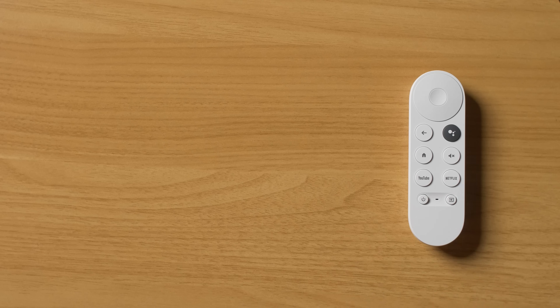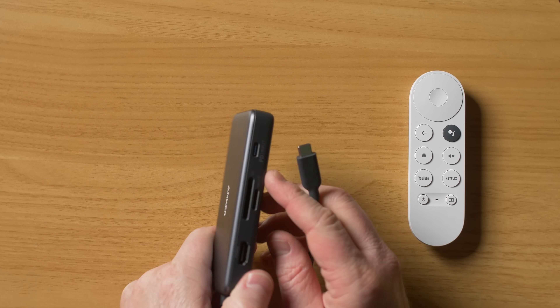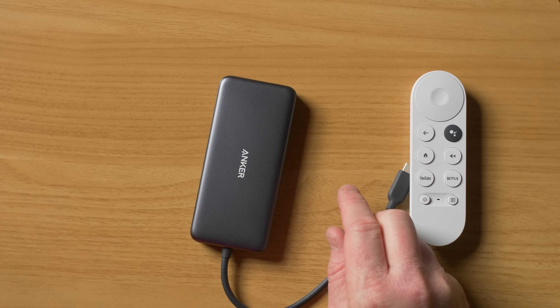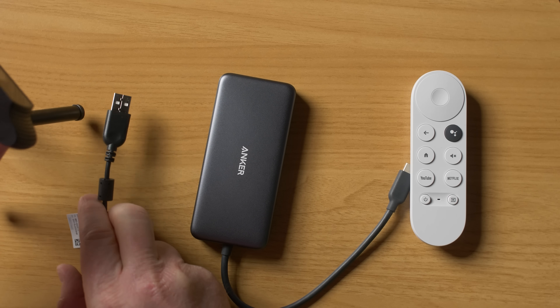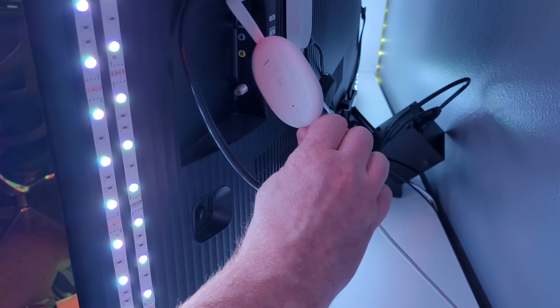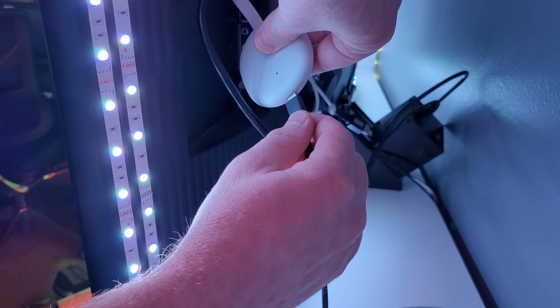Earlier, we downloaded the new Google Duo application that's available on Google TV, and so now you can actually use the TV to make video calls. So I'm going to show you how you can set that up. After setting up our Chromecast, the next thing we need to use Google Duo is a dongle — here I have a USB-C to USB dongle, and it also has an option for power delivery. This is going to allow me to continue to power the Chromecast while I use this. And then you also need to have a USB camera — here I have a webcam from Logitech that we're going to try out. So the power coming from the Chromecast cable is not enough to power the hub and the Chromecast. So I ended up finding another power brick that was high powered enough to be able to power both of them.